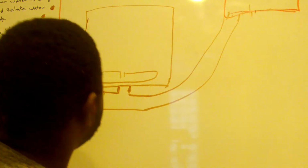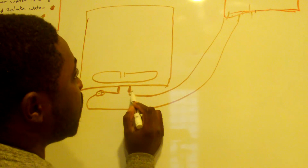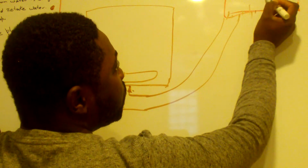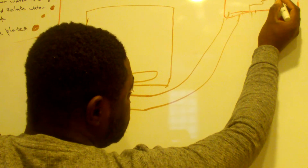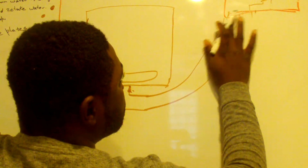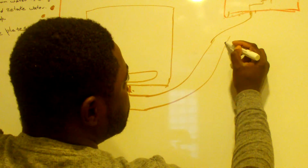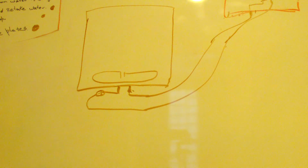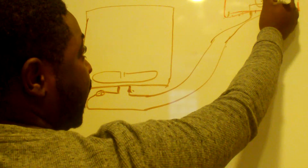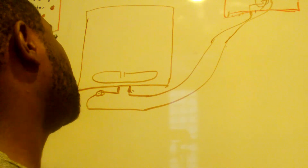Apart from that, if I test the thermostat and I'm okay, and I test the heater and I'm okay, remember, power comes here, it goes through a switch, and it comes back, right? If I test the heater and it's good, and my bimetal is good, then it's this part inside of the computer board that's not good. So I would need to replace the computer board for that.